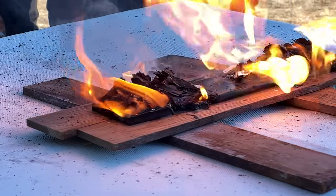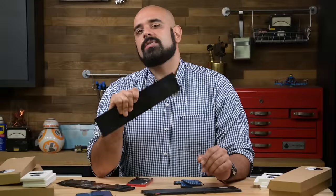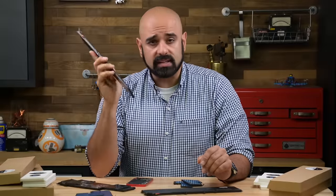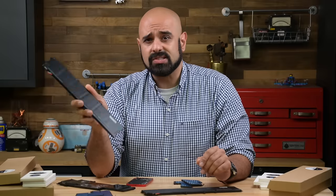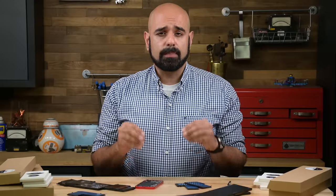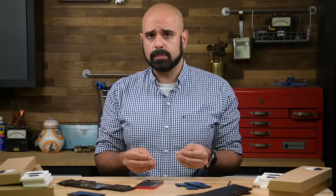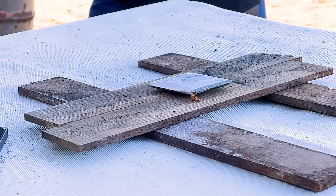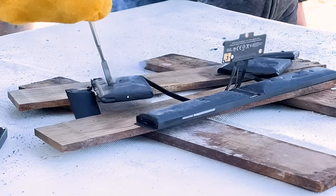Aside from the hassle of discharging a battery before starting a repair, it also poses a serious risk to recyclers. These fires can and do cost lives and cause untold amounts of environmental and property damage. A lot of manufacturers don't want replaceable batteries. They'll tell you that these things are just too dangerous for the average consumer to repair. We've just proven that that's nonsense. Just discharge your battery before you start your repair and you'll be fine. If you're fixing something with a larger battery, partially discharging that battery may still leave it with enough energy to combust if you have an accident. For cases such as that, discharge that battery to 0%. The battery won't be damaged if it's at 0% for just a short period of time. Not all swollen batteries catch fire or explode. The risk of combustion comes from how charged the battery is, not how swollen.